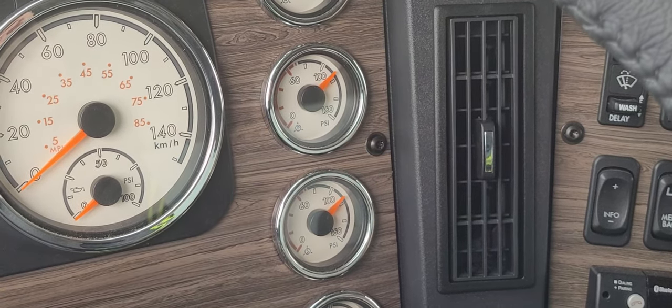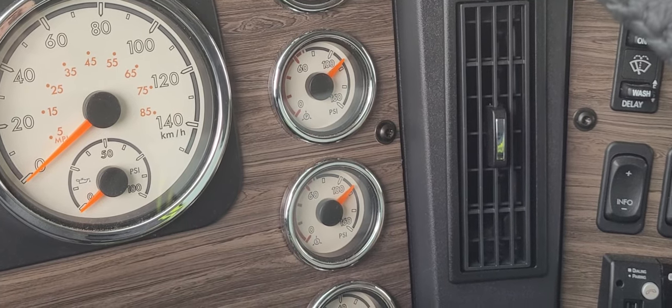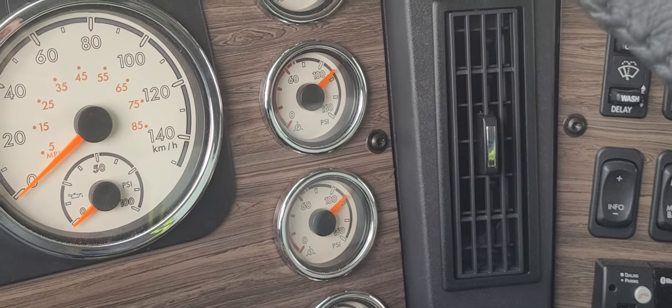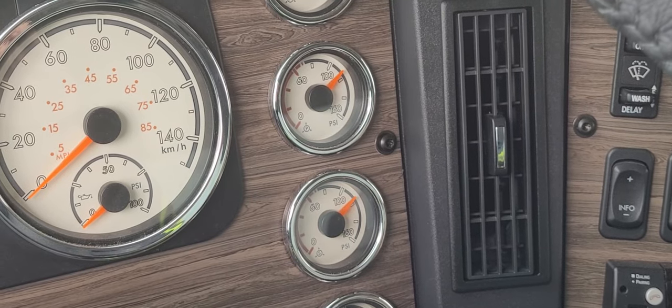2 minutes is a long time. It starts to burn about 20 seconds in. So after 2 minutes, you shouldn't lose more than 4 PSI, or any. If your system is sealed, once the gauge is stabilized, there should be no drop in pressure.